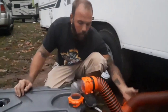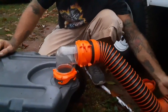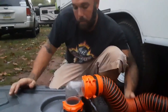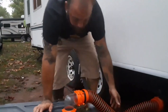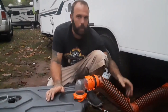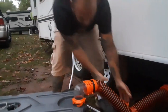The gray water is coming from your kitchen sink, shower, and bathroom sink - so you really don't have any solids unless kernels of rice or something like that get washed down accidentally. There shouldn't be any trash in it. That's one thing that's very important with the plumbing in your camper - you don't have the three and four inch piping like you do at home, so it's very important to minimize how much solids actually go down your sinks, because they're not designed to take chunks. We have drain screens for that.